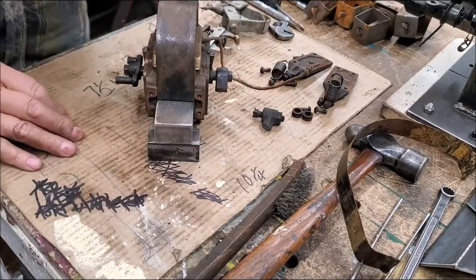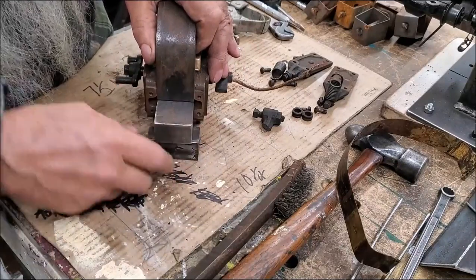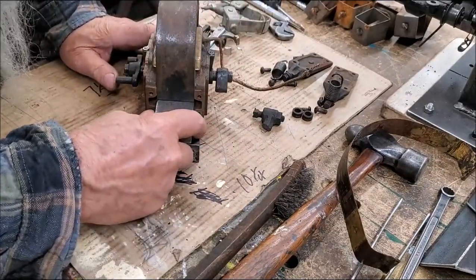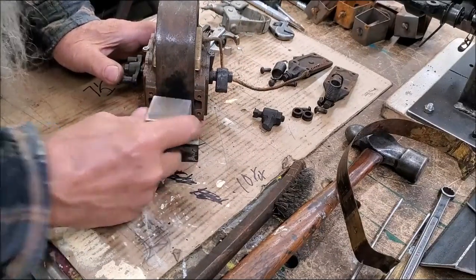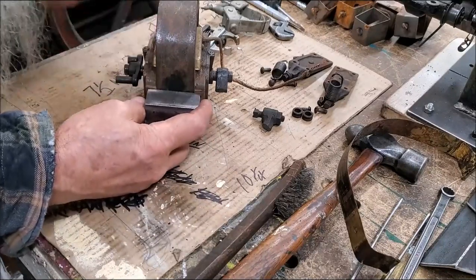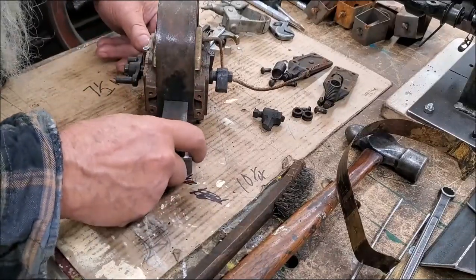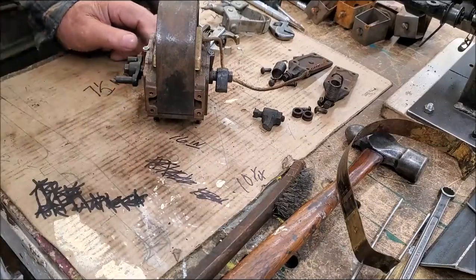In order to recharge this magneto, you have to take these parts off and get it down to where you can make contact with the charging machine, with part of the setup just about like that right there. Making good contact all the way across, down toward the bottom — that's going to work out just fine. I just cut these out, just made these. That'll work fine right there, full coverage. A little distance there where it's not holding could hold the metal part away, so you would have to set up like this, which is probably permissible. Anyways, the charging is the objective.